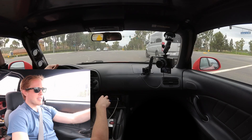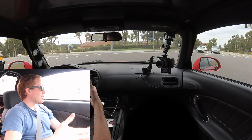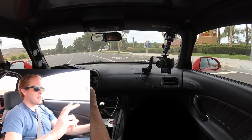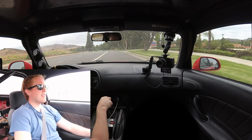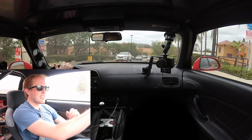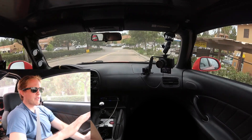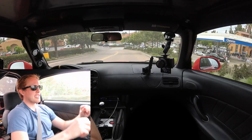One last thought about installing the kit: the bleeding procedure took a long time. I used two full containers of Motul to get all the air bubbles out of the Stop Tech caliper. Some people messaged me saying their Stop Tech brakes felt squishy — I do not think they should feel like that. My S2000 pedal has never felt more firm and responsive than with the Stop Tech kit.